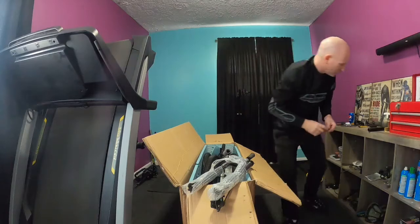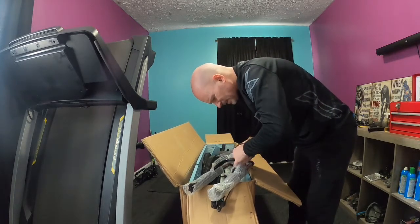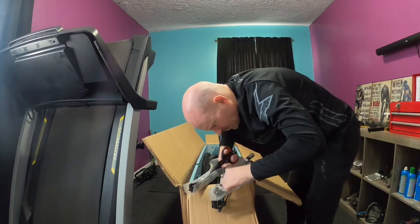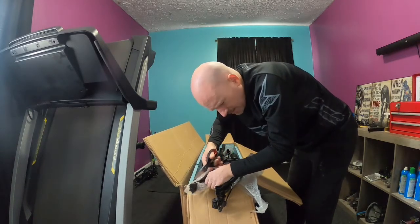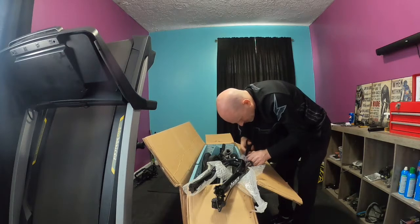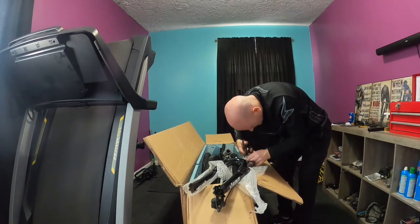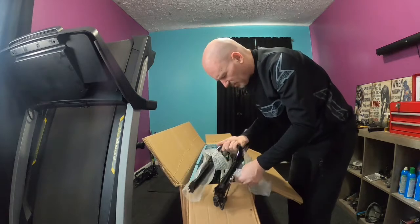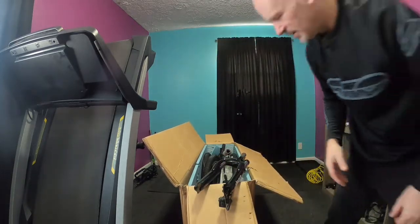Just a typical seat clamp, nothing special. There's some kind of fork — cheap and basic with a manufacturer sticker slapped on it. It's a disc mount, and I've got some Shimano calipers I'll probably swap in. Also, this bike has grip shift, and I'll more than likely swap that out sooner rather than later for a rapid-fire shifter, since I prefer rapid-fires and I've got terrible carpal tunnel from all the years I've ridden.